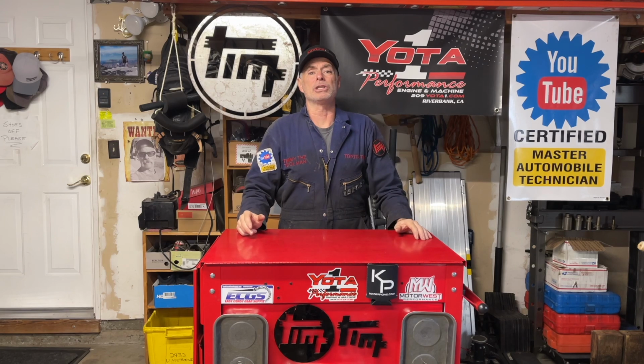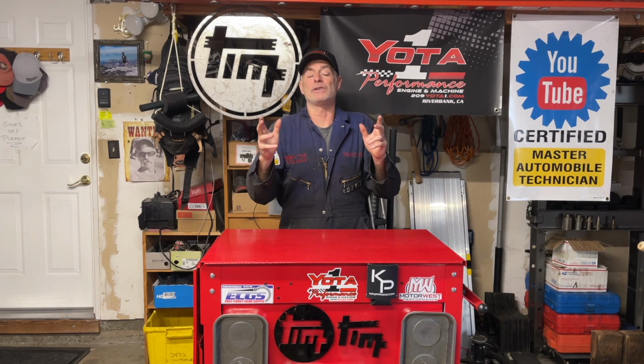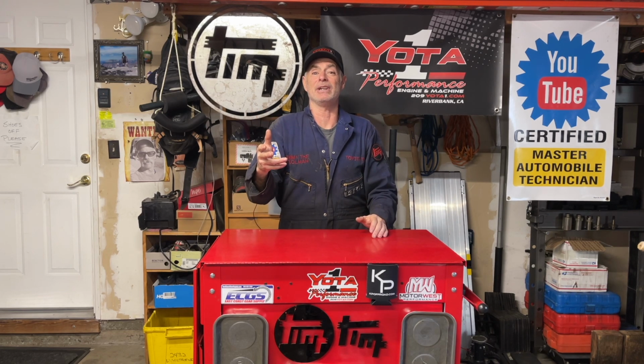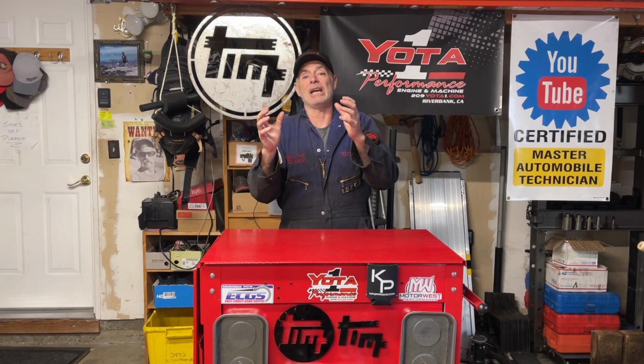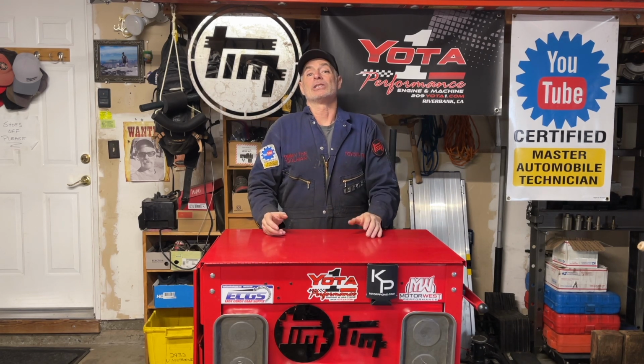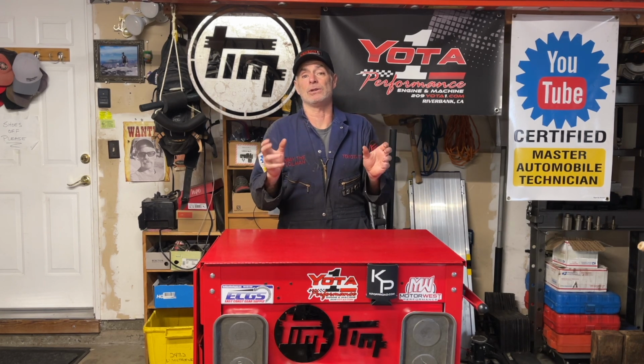All right, we are all done with this job. As you saw, it's a little bit involved to do a brake job on a 100 series Land Cruiser or an LX470 because you have to take the rotor and hub assembly off so you can remove the rotor. So it's a little bit more involved than some other Toyota and Lexus SUVs and trucks.